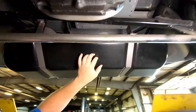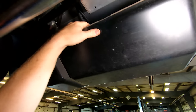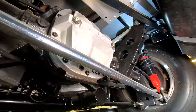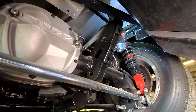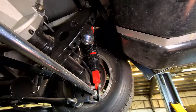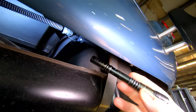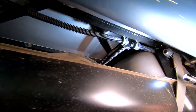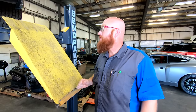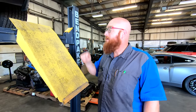The fuel tank setup is different — there's a plastic cover with the tank up inside, whereas the Superformance was metal. Here's the battery tray and a fuel filter right above it. We have adjustable rear shocks and disc brakes all the way around. On this one, you can actually see into the area above the fuel tank, which you couldn't on the Superformance — just a difference in design, not better or worse, just different. Nothing serious going on underneath this Factory 5 Cobra replica, so let's get it back on the ground.